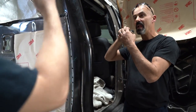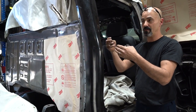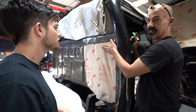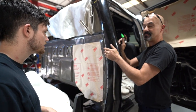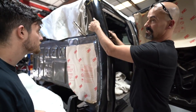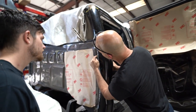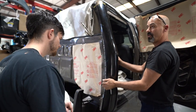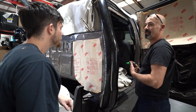Yeah, one little dink. You notice there's not a hole out here, but there is, because from the factory, they weld the cab panel on last. This is the piece that's furthest to the outside. So they actually weld this onto the inner structure, and then the cab. So there are actually hidden welds that you don't see, that we need to go back and just drill a hole, so that we can replace every one of those factory welds.